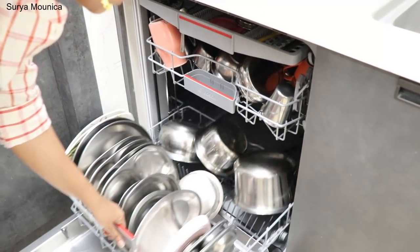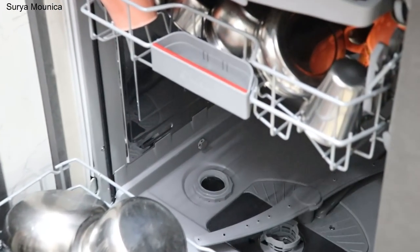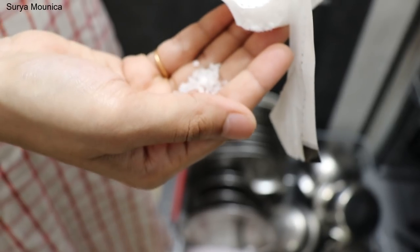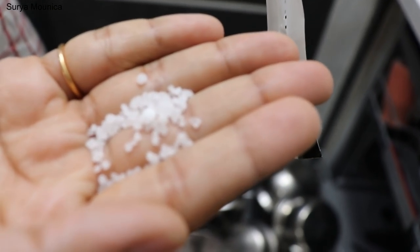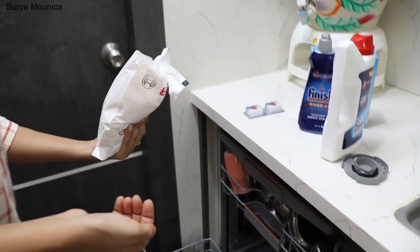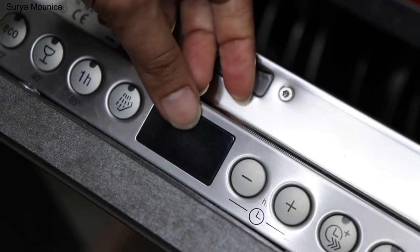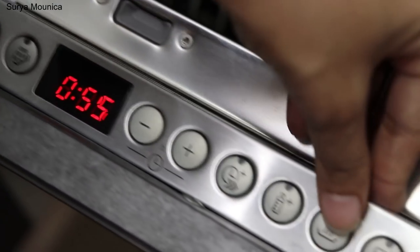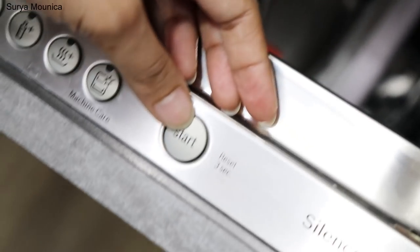We have the salt. I will fill the salt in the hole. I will fill the salt in the dishwasher wash compartment in the first place. It uses small granules. Use dishwasher salt. The salt compartment is indicated by the salt symbol. I will fill it. It will take about 55 minutes to finish. I will close the lid. When you watch it run, there will be a red light at start time.